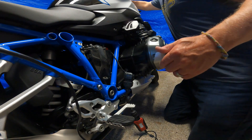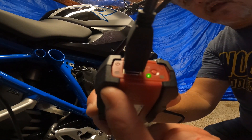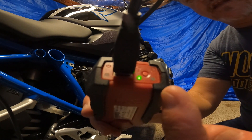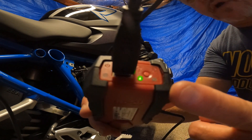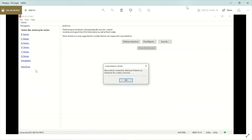Once you've done this, power up the bike. On the bottom of the GS911 you'll notice some LEDs. The first LED, farthest to the left, indicates power — it starts out blinking quickly and then slows down as power stabilizes. The second LED is Wi-Fi and should be glowing steady. The third LED is for direct device-to-device connection, used for example if a buddy broke down on the side of the road and you wanted to connect to their bike to determine what fault was present. Once the app opens and identifies your bike, it almost automatically comes to a 'perform auto scan' prompt, so I'll say OK and perform the auto scan.